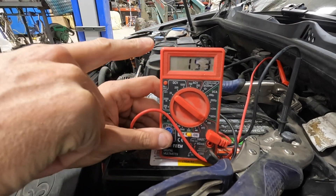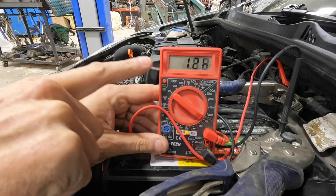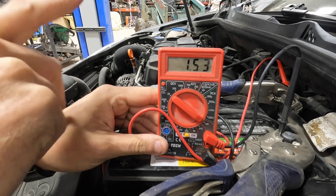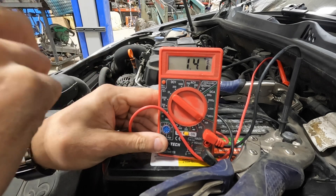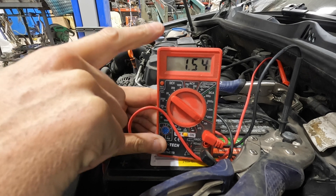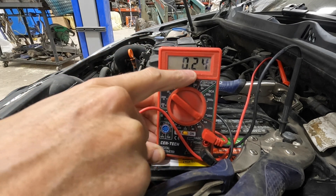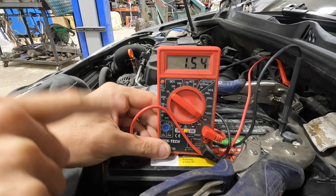So we've got this hooked up. And as you can see — 1.5 amps, and it fluctuates a lot. Something's going on. There's nothing on in the car, no lights on. So when you start this project, make sure everything's off in your car, the doors are shut. Your computer will draw some, but it should probably be like point-something — not whatever that is.